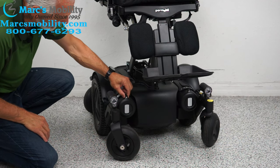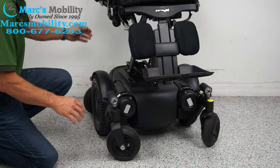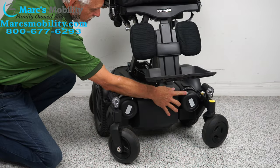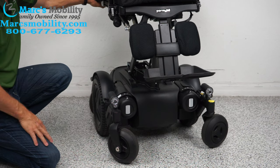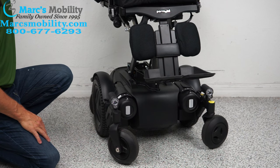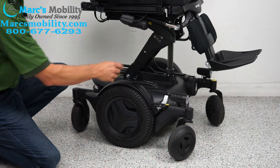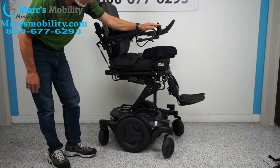With the power off, you can see on top of the motor there's a little screw and a little handle — that's your lever. Push it inward on both sides and you're in neutral. See how the chair rolls? When you're done, make sure you put it back in gear because it won't work if it's left in neutral. Turn the power back on, give it about two seconds, and you'll also notice the armature and actuator for the seat lift.